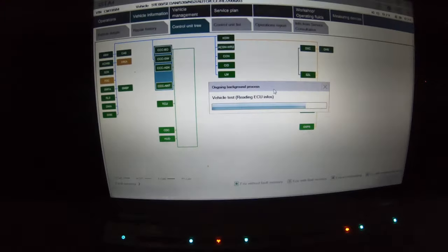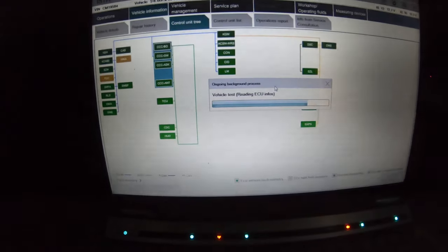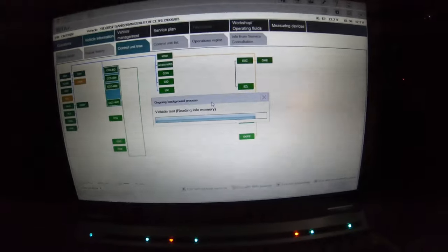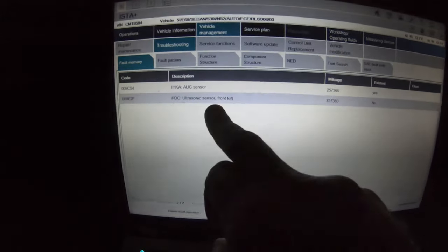So here at the car — I don't know if you can see correctly because it is quite dark here — but I've got right here the PDC button flashing, and then they decide to come back on and come fully functional again. They are messing about a bit; it was just flashing and the PDC keeps going down. I don't know why they've just started working again, but they weren't working. You can see there's a PDC fault right there — it did give a fault and all of a sudden it worked, which they do. The PDC module fault is there and it's showing: ultrasonic sensor front left.